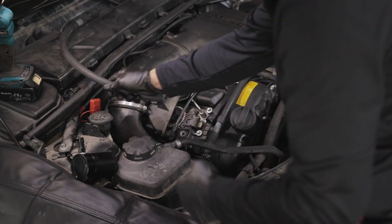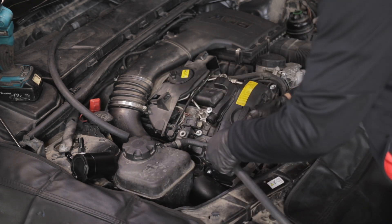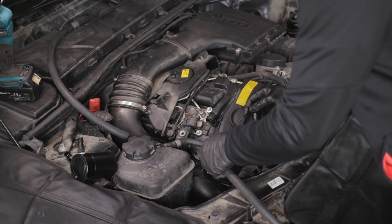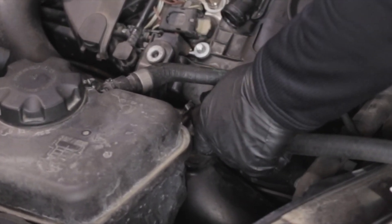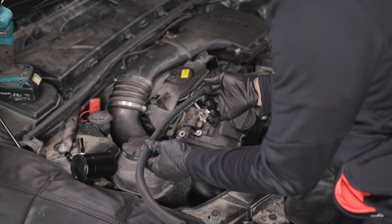Because the adapters are so long, you can always use your imagination and use something smaller or more appropriate. I'm going to have to twist this one 180 degrees — I'll still secure it with one bolt but not two. It's really important to keep the hoses in the right order as you connect them into the oil catch can.